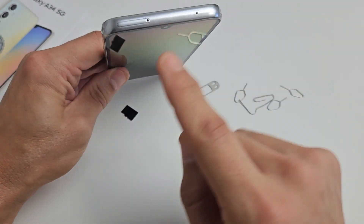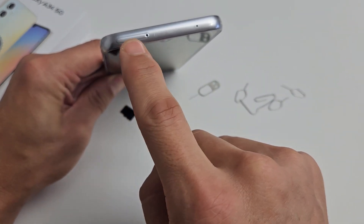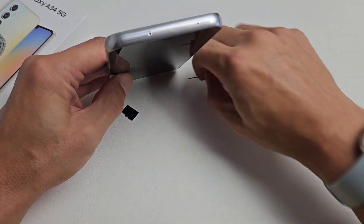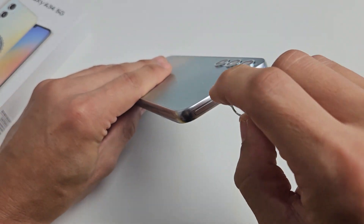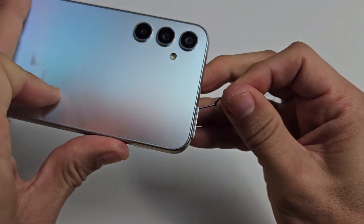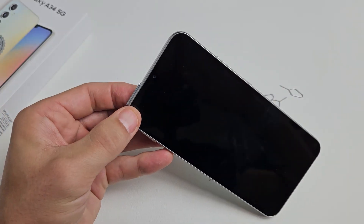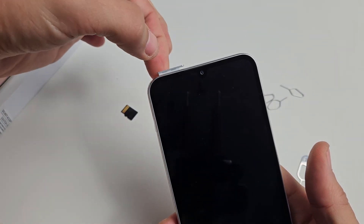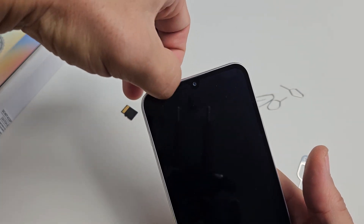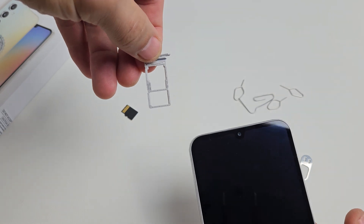On the top left-hand side, you'll see that little hole right there. You can see the outline of your SIM/SD card tray. Go ahead and put the SIM injection tool needle in there, and then press towards the phone. When you do that, you can see the lip here come out just a little tiny bit. So you can see it right here — go ahead and pull this out just like this.